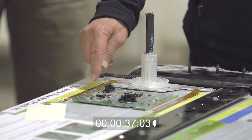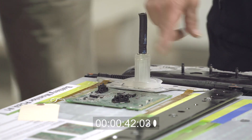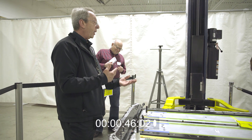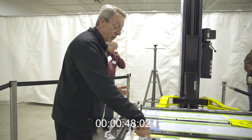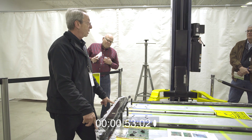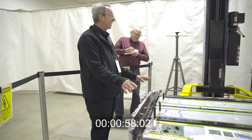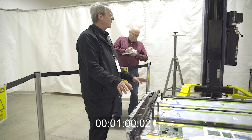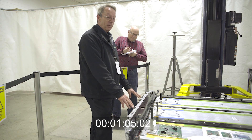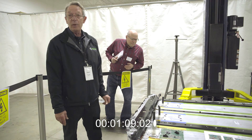They stitch bond two ribbon cables to this board. Voltage in and out of the battery pack is monitored through that ribbon cable. Everything on this battery pack is glued together - there's not a component in here that doesn't have glue on it. They did not want me getting inside their battery pack. I had to hammer and chisel the cover off. So this is not a maintenance-friendly battery pack.